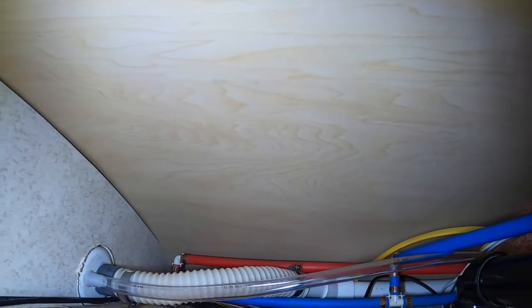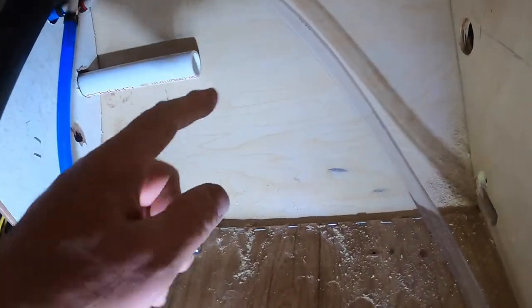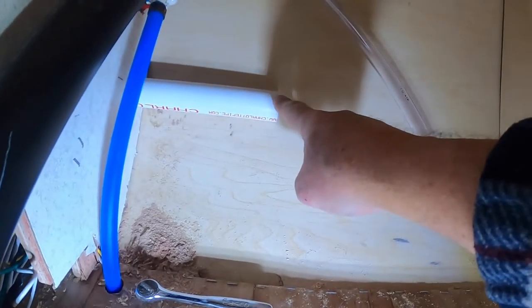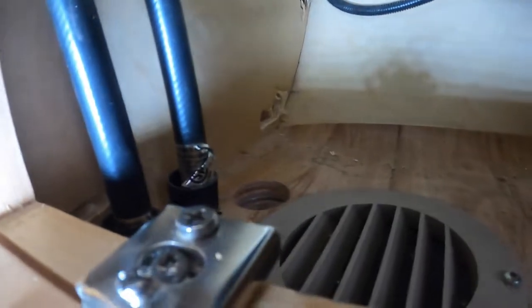We have finished. Let's get in the back of the bathroom here. Get some light in there for you. We have connected, you see the water filler neck there? And it connects, so it passes through the back of the bathroom and comes out in the kitchen cabinet. So today, we're gonna connect from here. I've drilled all the holes from the back of the kitchen cabinet into the refrigerator cabinet, underneath the refrigerator, from the back of the refrigerator cabinet, down through the floor, and to that tank.